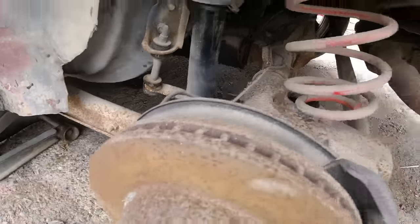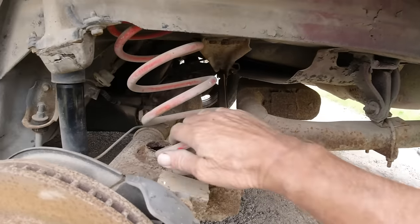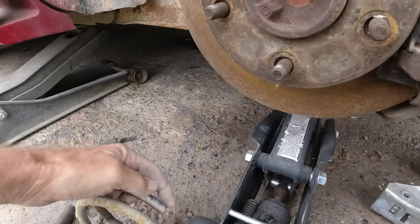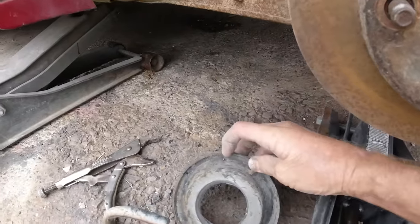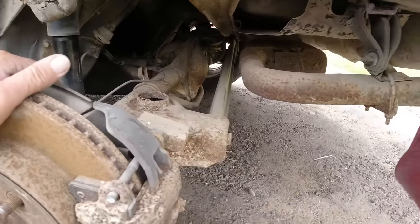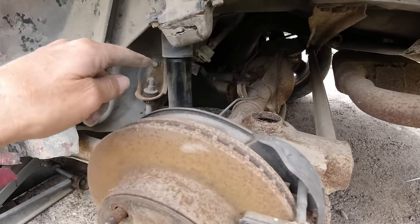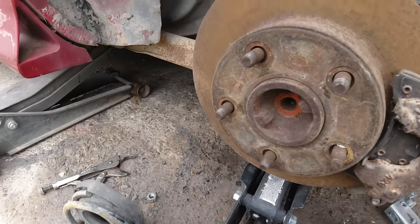Just undo the shock and pull it away. The bolt was stripped on there — not rusty, just stripped. I've been using this little pry bar since I can't find my big crowbar. Pop it up like that, then put your old one in — make sure it's on that edge there. Crawl underneath, kind of hold that on there, stick it back in. Once you get the spring in, just put the shock back on, jack it up a little bit, and that's it. New shocks haven't arrived yet — I've got new shocks coming for the back.